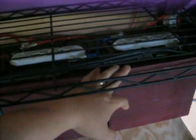Then I've got basically two 6-volt golf cart batteries and a 12-volt car battery. The two 6-volt batteries are connected in series — joining negative to positive — which bumps them up to 12 volts and creates one bigger battery at 210 amp hours. All the negatives are connected together and the positive goes through to the main positive terminal.